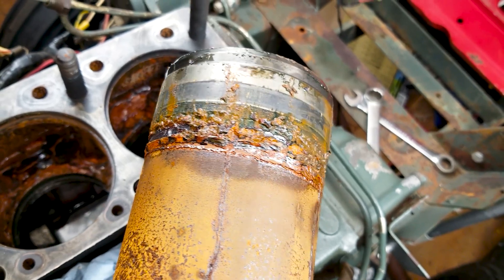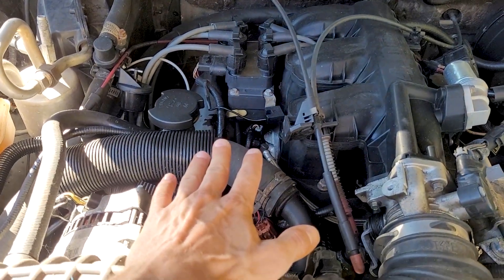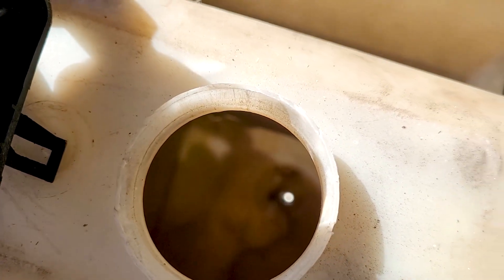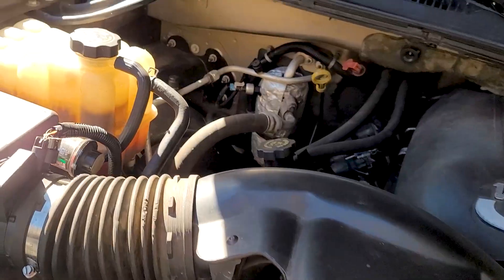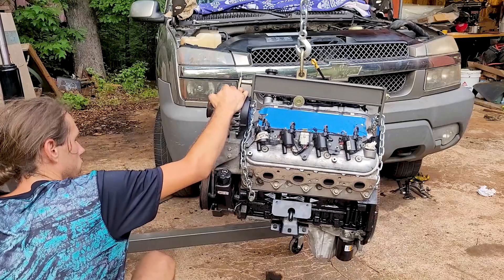The antifreeze is supposed to protect this stuff from rusting and help lubricate it. It's supposed to last like five years — it ain't working right. This Ford Ranger 4.0 overhead valve has got a cast iron block and cast iron heads. This thing was nasty, but I got it flushed out now and you can see it ain't that dirty. So this Vortec V8 on the Chevrolet Avalanche — formerly abandoned — it's got a cast iron block and aluminum heads. You can see there's a bunch of gunk in the radiator reservoir, but I got in there, flushed it, cleaned it, and replaced it. It's still got a little bit of gunk but it's not full of rust like these other engines were.